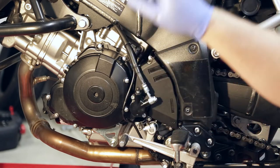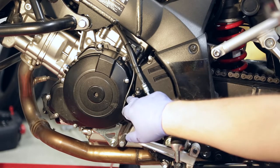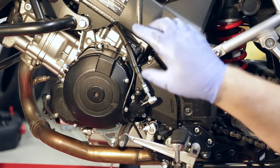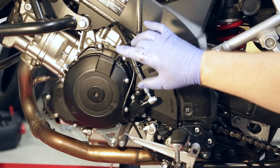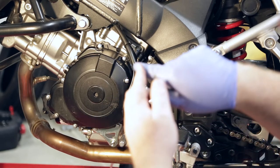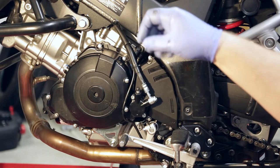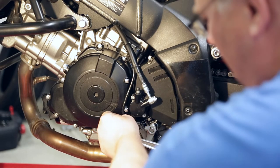Here's the problem people have with these. We get them on even but don't tighten all the way in. Now we're going to cut that zip tie off the clutch lever, then slowly alternate back and forth to bring the cylinder in — but don't go too fast. The problem is if you get too much pressure, it takes the outer clutch plate on the clutch basket and can push it out, causing the disc to rotate. Then when you go to take off, you'll think your clutch is burned out. As you push this in too far, that rod pushes the clutch apart too far and the clutch plate gets stuck. Sometimes you can unscrew the oil filler cap and pop it back with a screwdriver, but if you do it like I'm showing you, you shouldn't have that problem.